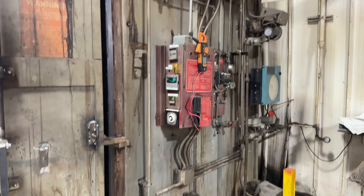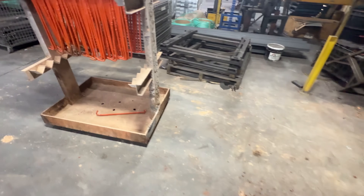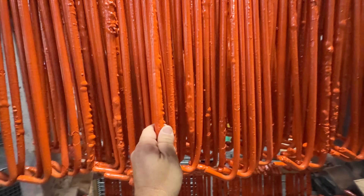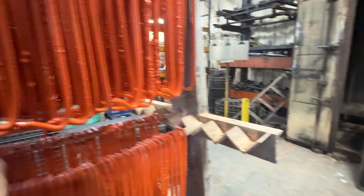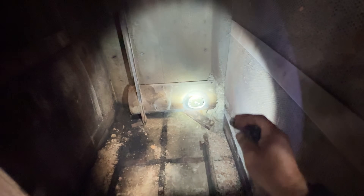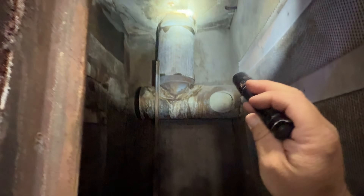So this is the device we're working on. It's a big firing box, and what they do is they run these hooks in there, and they've got to burn that crap off, so they get real super hot. The way this thing works — I just learned this a little bit ago — you've got a firebox here, and you've got the burner down here at the bottom. It shoots into there, heat comes out, and it gets hot in here. Then you have your afterburner here, which shoots the flame out and then goes right up the stack.